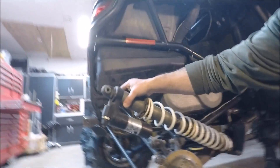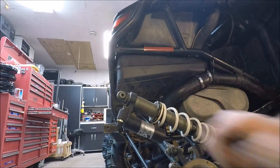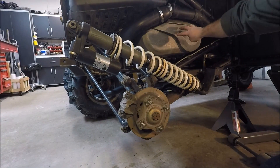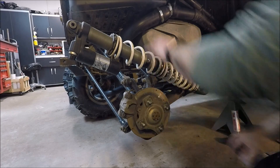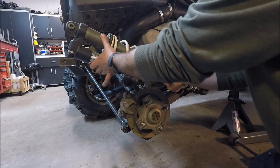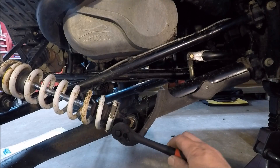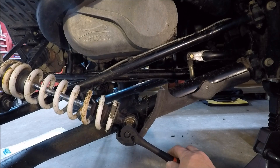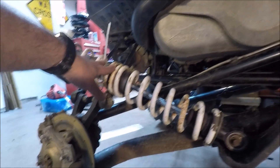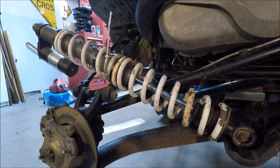Okay, we've got that out. Our shock is going to be able to just come down. Got that laid down out of the way, so we can get in here. I'm going to take a zip tie to hold it off to the side so it's not falling and crashing down. The nut on the bottom is also a 13mm — we could pull the whole shock, but I just got it zip tied off to the side so it's not going to fall down while we're working.